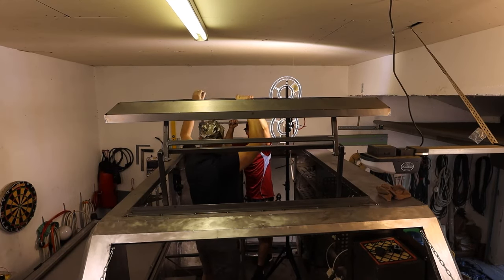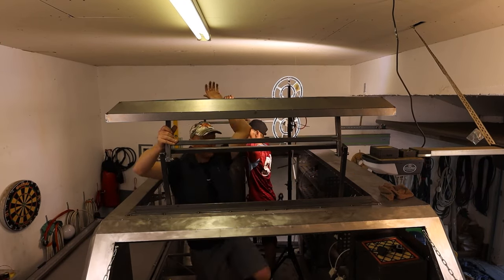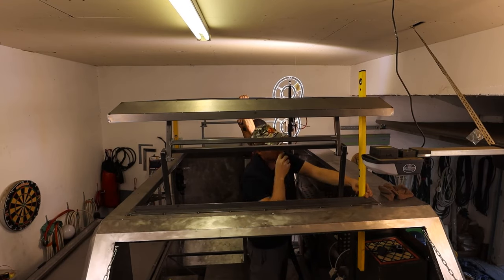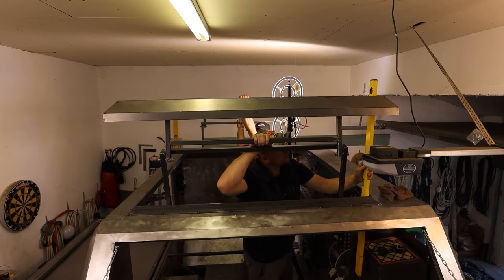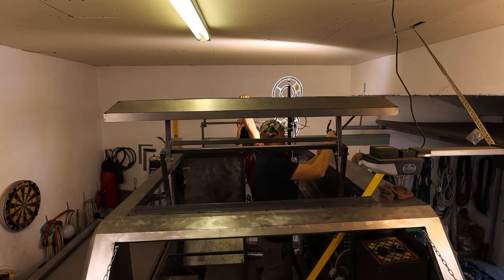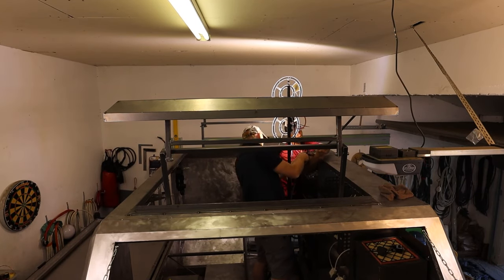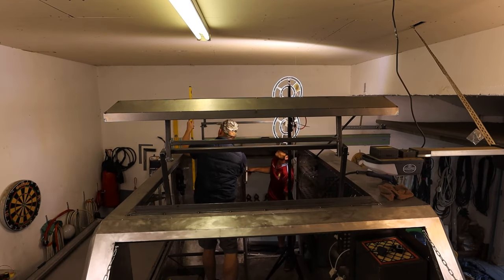Here you can see us lift the roof for the first time and everything works great. With just the lifting handles installed they keep the roof from moving left to right, but the roof can still go forwards and backwards to the point of bending the arms and collapsing. After making sure the trailer is level across all sides, I used the bubble on the spirit level to find the spot where the roof is exactly centered over the opening. I then welded a temporary piece of steel that keeps it perfectly still in place so that I can install the shocks.